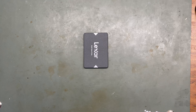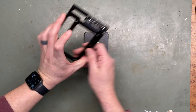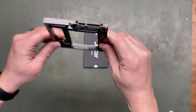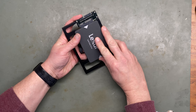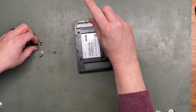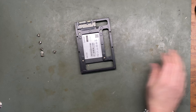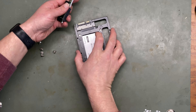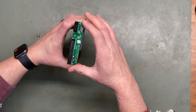Let's go to the workbench, pop this iMac open, and get this thing replaced. For this upgrade I'm using a 128 gigabyte Lexar SSD in a 2.5-inch to 3.5-inch frame for easier mounting. Since the tray-loading iMac doesn't have SATA, I'm also using an IDE to SATA adapter so they can talk to each other.